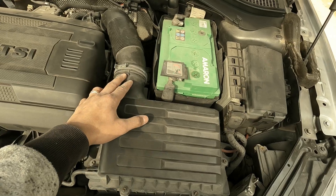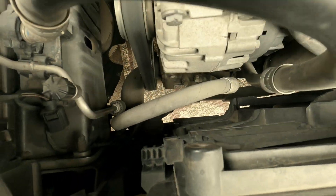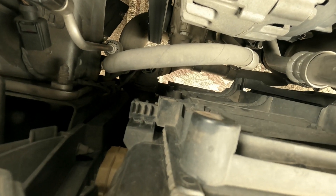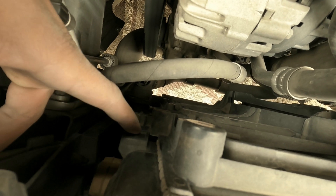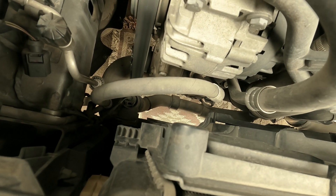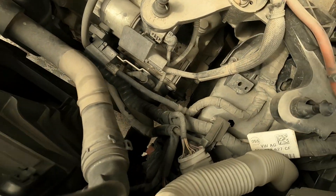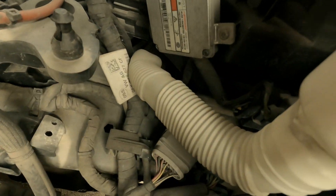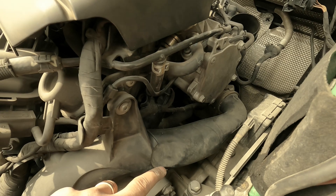The airbox is removed and the sump shield is also removed from the bottom. We have to remove the radiator shroud — you can see the radiator holder here. Press the clip and pull the radiator shroud upwards; same on the other side. Before removing the two clips, disconnect the radiator fan from the electrical system using the coupler — pull the tab, press it, and disconnect. Then you can pull the fan shroud out.